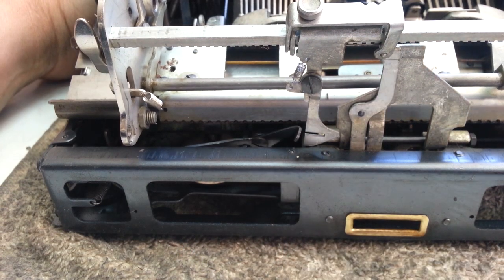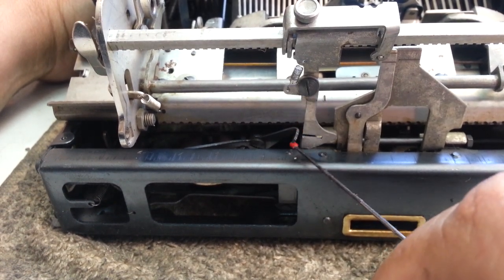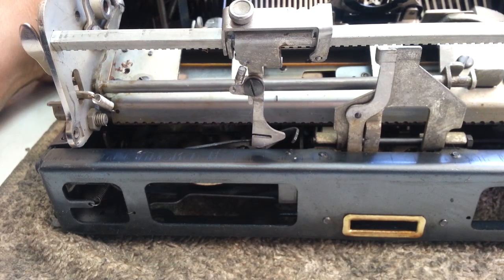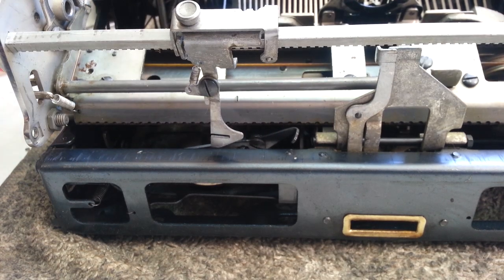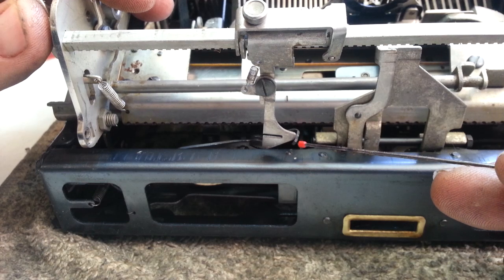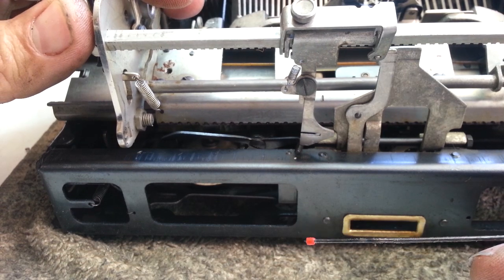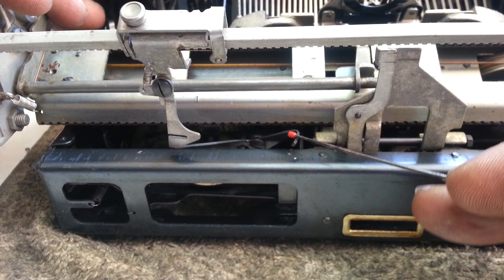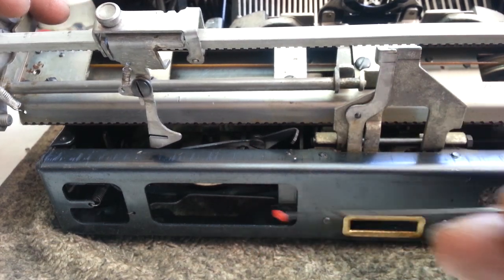And that's that. When it goes backwards, back over that arm, this piece collapses and goes back over that. So we're going to go backwards over that, just like that, and it resets. So let's do this again. I'm going to do it manually here. This piece comes, it's got a little angle on it. It's going to come right to there and start moving that arm down. When it gets to the end, it's going to snap. And that's it. There's a spring on this piece, right down in here somewhere, right about there. And then the clapper cannot touch the bell.